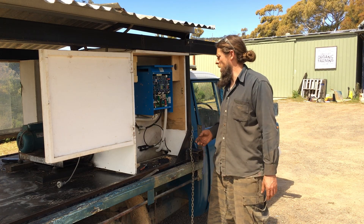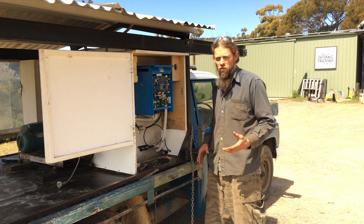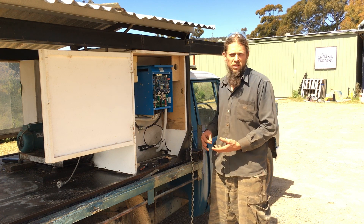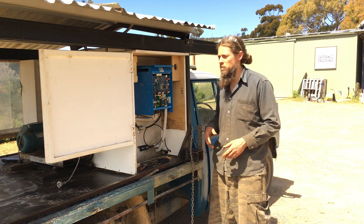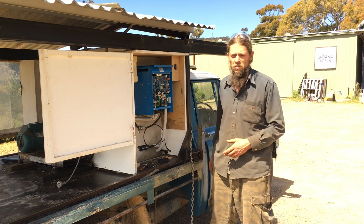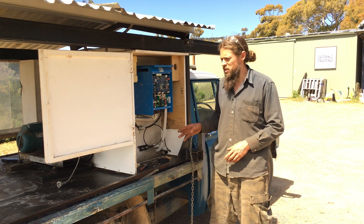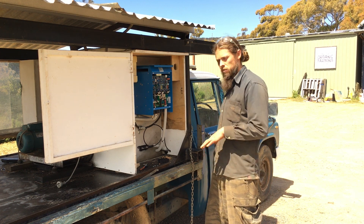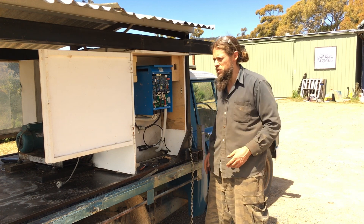We've got the slip-on on and I've been connecting up the inverter. We had to draw a line in the sand — are the batteries on the slip-on or on the vehicle? We ended up putting them on the slip-on because we already had a battery enclosure that exactly fitted them, and the slip-on needs to be able to work separate to the vehicle, because if the vehicle has mechanical problems, the slip-on's still got to go out every day to milk. Batteries are in the slip-on, which does make for a slightly amusing process where you have to roll down a slope to get out from under it.